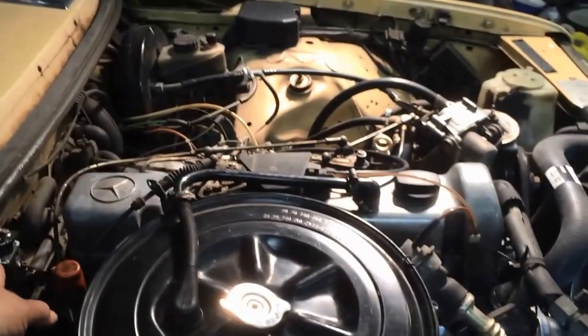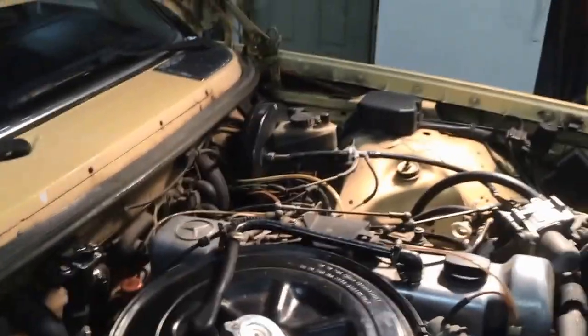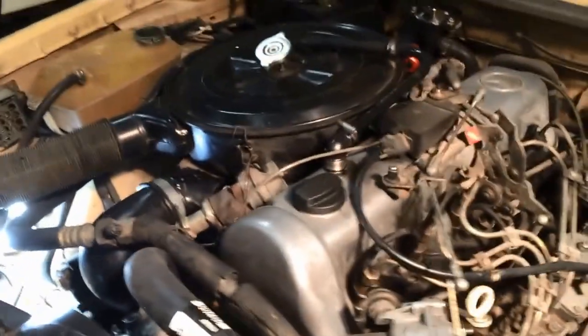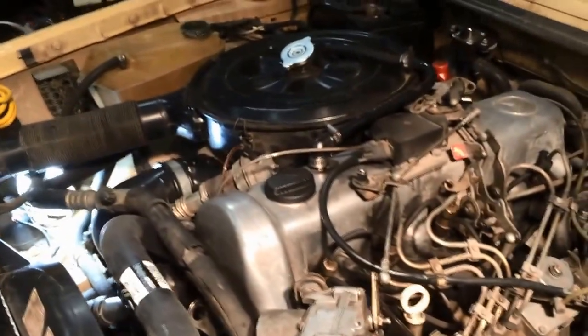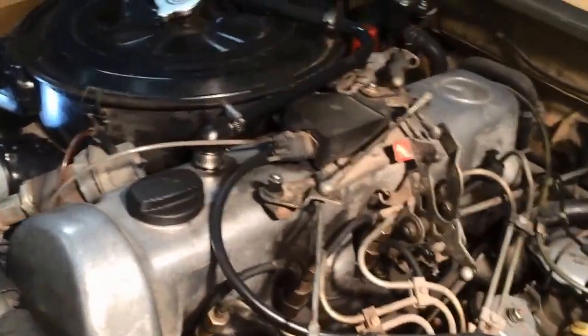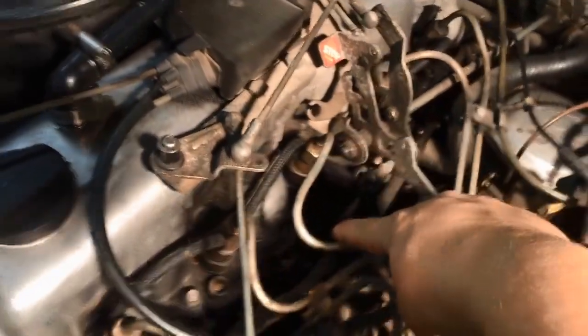This is kind of working. I mean, I can turn off the heat, but getting it back, I have to shut the car off, turn it on, and it resets everything, and you get heat in the car. It's really random. Temperature is running at about 100 to 105 centigrade. A little too hot for this car, so I got to figure out why. Hopefully, it's not a head gasket. It's possible. Down here, the temperature sending unit, I guess, is down here in the back somewhere. I think it's right here. Right there in the shadow.